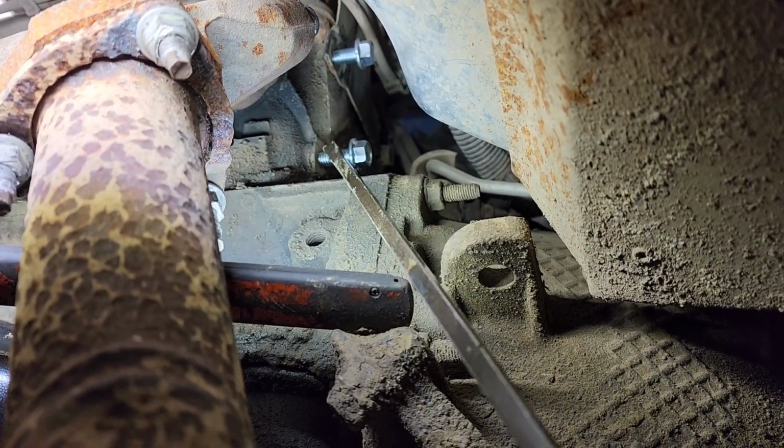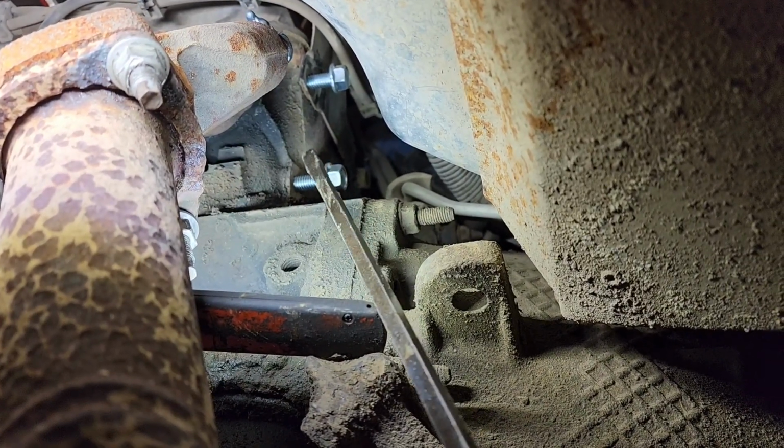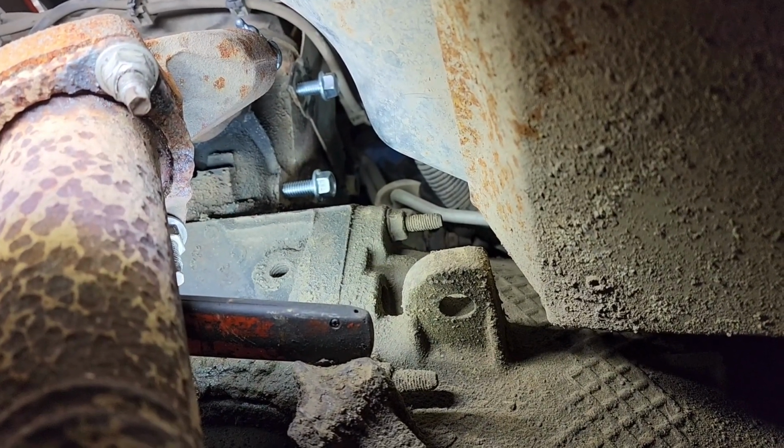The other hole we're going to use is further down. It's right on the bottom of the cylinder head. It's pre-drilled and threaded. It may be pretty dirty. You might want to take and run a tap in it, or at least a bolt with some oil and run it in and out of there to make sure you clean up the threads.